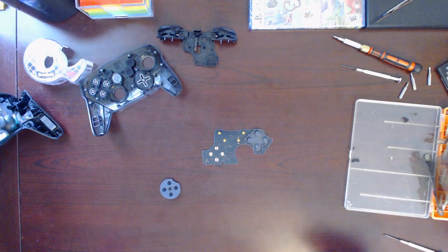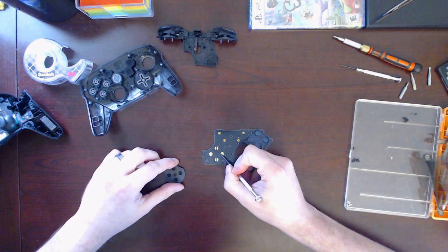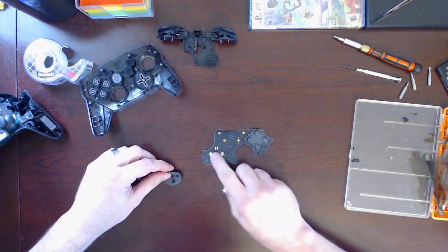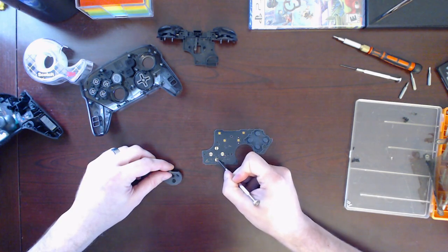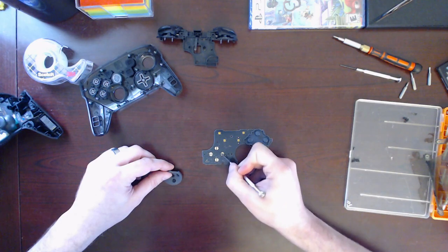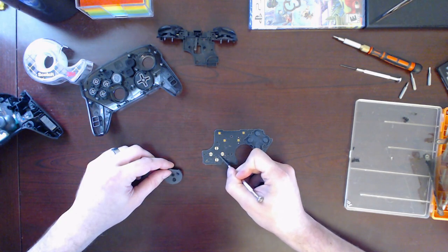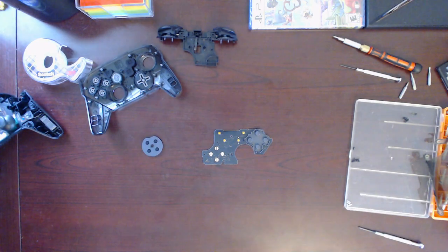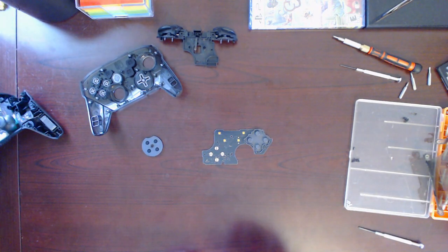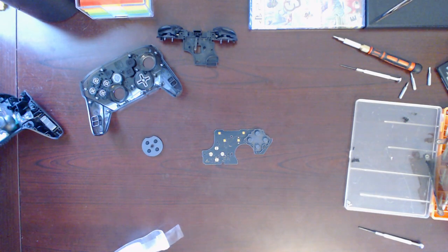So, the solution that's suggested is to desensitize these near the center so that when you're going back and forth, if they incidentally contact around here, that's not registered going up and down here. So basically we're making either a circle tape or just little sections of tape to basically insulate those right at the very ends there. So go ahead and put that on. This is the part that's going to be a little bit tricky. Getting the tape the right size and the right position.